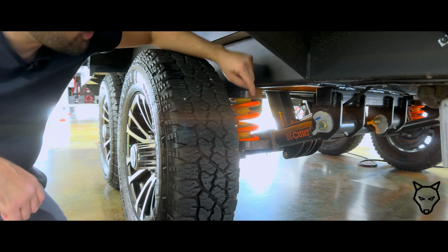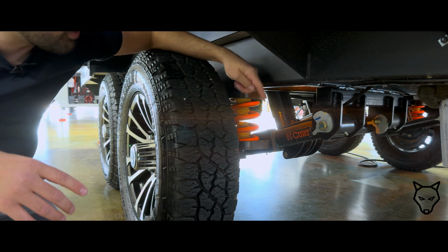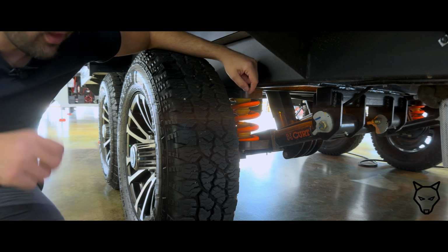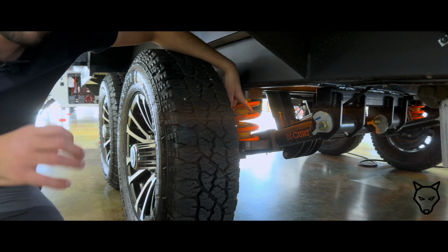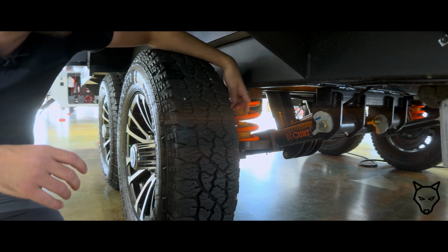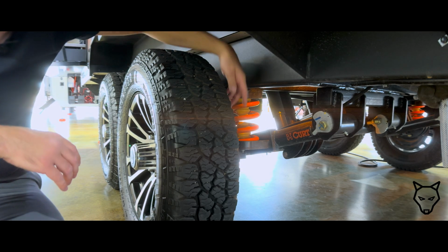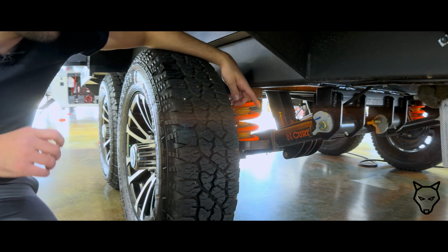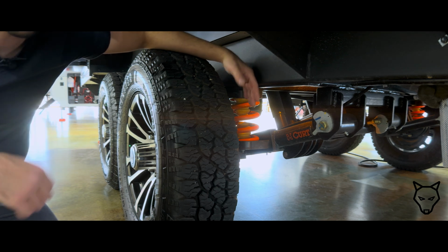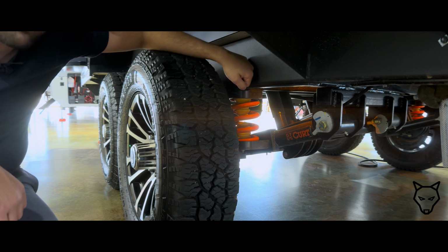So what's going on here? Well, CURT, as a division of the Lippert Industries company, has come out with this independent trailer suspension. The style of it is considered a trailing arm suspension, and you can see here that instead of using the rubber tubes, like the tube in tube design you would find on the Dexter Torflex, this is using a coil spring. They also, interestingly, have 2 shock absorbers on here, and speaking to some industry professionals, this system is heralded as being number 1 in terms of total suspension travel. So that's what we're going to be testing here today, but I wanted to give you a close-up look of what we're doing.